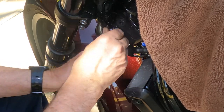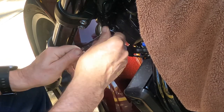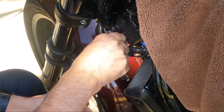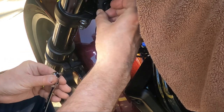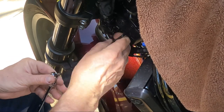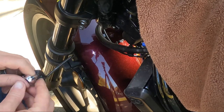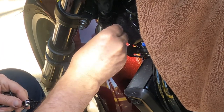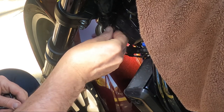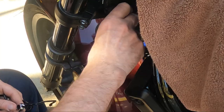Before you rush off to order the service manual, be aware that it doesn't help much. The wiring harness bracket is easy to remove, however, the information in the service manual about how to remove the wiring harness cover is vague. I found another illustration at page 131, but no instructions about how to remove it. All I could achieve was unscrewing the screw holding the cover. I couldn't figure out how to remove the cover without breaking it, so I left it in place and just moved the cover and harness out of the way later when I needed to.